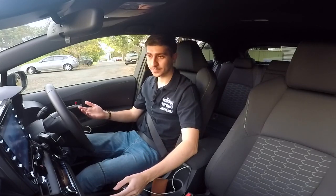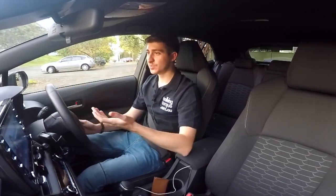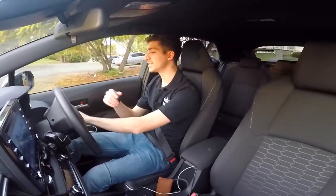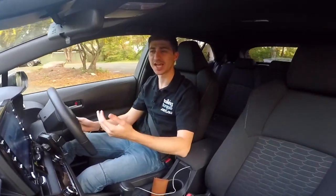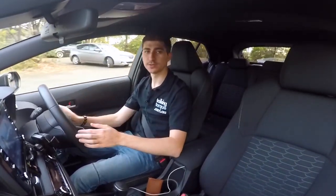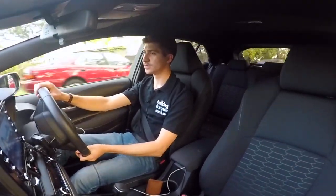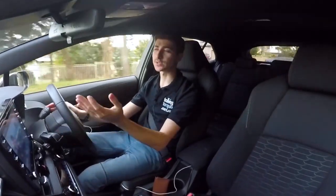There's enough charge for the hybrid motor to work, so I'm going very slowly — purely in electric mode — only up to 5 to 10 km/h, but it could easily go to 20 to 30 if you push it purely in electric mode; it just depends on how much charge it has. Now we're going 10 to 15 km/h, still in electric mode. And there's the petrol engine — now we're at about 30 km/h and that's where the petrol engine's kicked in.